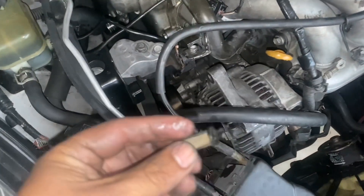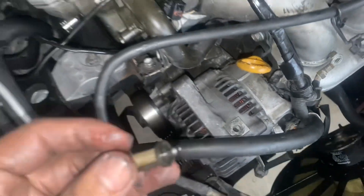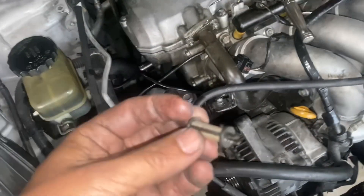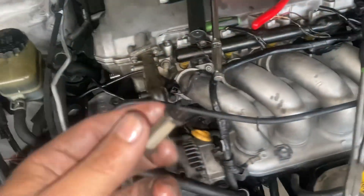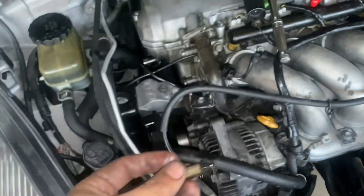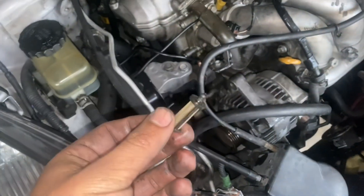This is the filter that goes right there — size 14. You could do it without taking the alternator off. I loosened it up, but I've done it before where I don't even have to loosen it. I cleaned it up already and I'm going to put it back in and test if lift works. If not, I'll check the other one, but I'm pretty sure that one's clean because I replaced it — had a code for a no-VTEC code and I swapped that one and cleaned the filters.